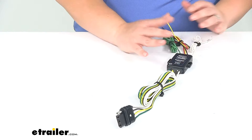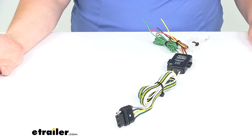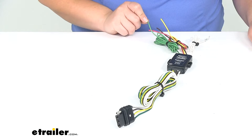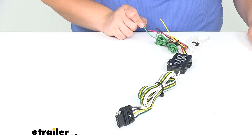This doesn't come with any butt connectors, zip ties, or self-tapping screws, so those are all things you'd want to pick up to complete your install. You can find all of those accessories at eTrailer.com, including heat shrink butt connectors, which I'd highly suggest if any of these connections have to go outside the vehicle — they'll keep water, dirt, or debris from getting into that connection and causing corrosion issues.